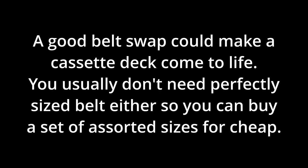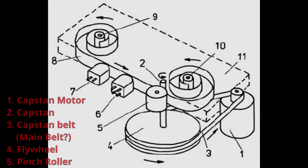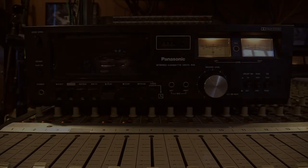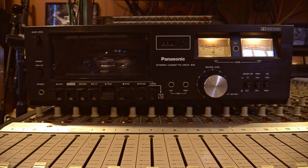As I'm recording this voiceover, the crazy glue is holding and the spring is staying in place. To fix the tape counter issue, I wound up swapping out all three belts — but after changing them, the transport system became inoperable again. The belt that goes around the main capstan motor was just too small and tight, putting too much stress on the bearings. I attempted to stretch it out but that was no use, so I put the old one back on, which was honestly in pretty good condition anyway. The reverse function was still a little sluggish, and I'll address that later once the machine is calibrated.